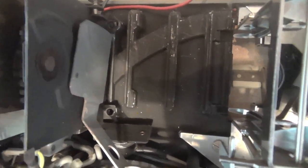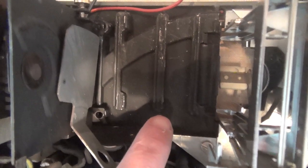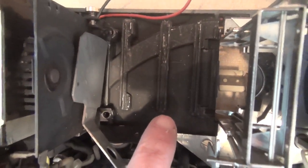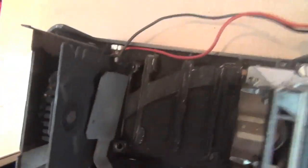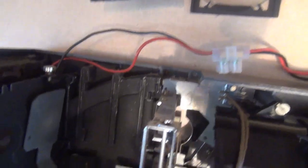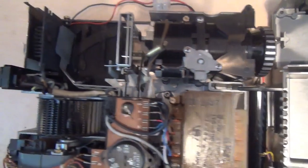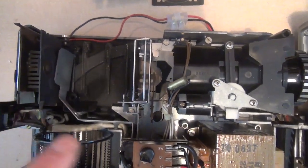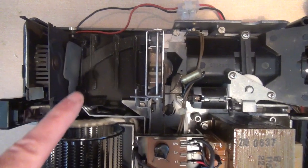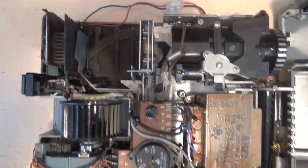There are two condenser lenses. Also there's a slot which could hold a heat filter glass — you don't need that. The LED is so cool in comparison to the old halogen lamps that you really don't need that, so if there's one in there, you can leave it out. You can see here where I've taken the low voltage line, and that goes out to the driver that's going to be stuck on the front of the machine, so it's a straightforward power line and then low voltage line straight to the LED. Switching is done on a separate external switch that we have to organize.